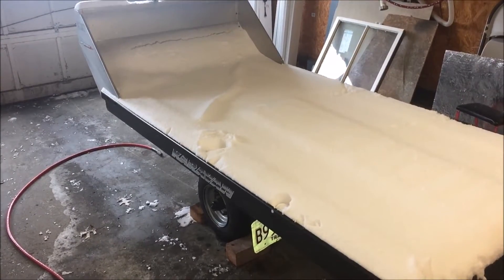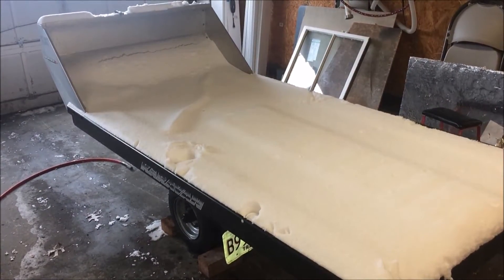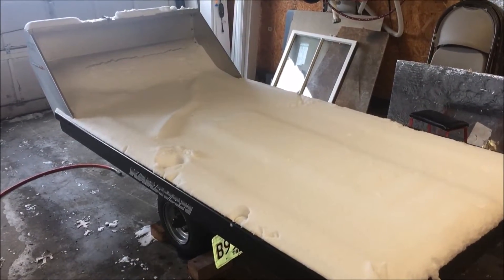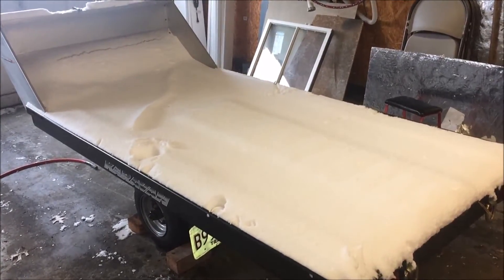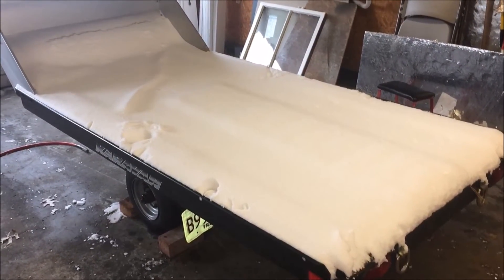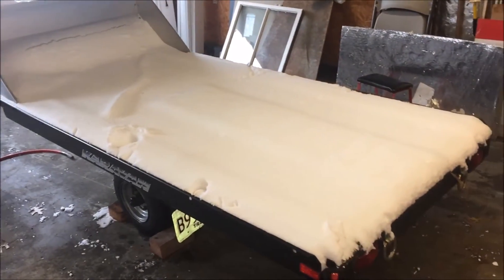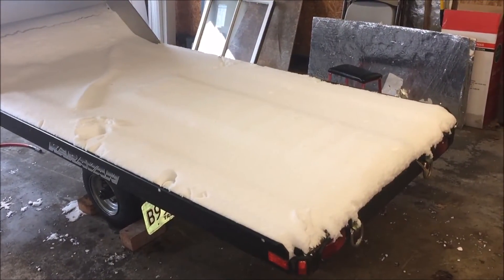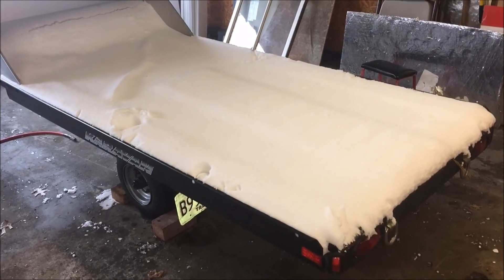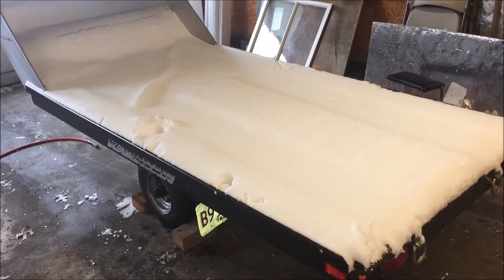I figured I'd just pass this along — this is the basic stuff I do to make sure the trailer is good to go before I leave the house. Another thing I do is bring a jack, a breaker bar, and the tools to take the lug nuts off. In the event you're on the side of the road, if you have those tools handy you can take care of an issue in five or ten minutes. If you don't have that stuff, that's really when it turns into a giant problem. Hope this helps everybody out — leave any questions in the comments and I'll get back to you. If you liked the video give it a thumbs up, subscribe, and thanks for watching. Have a great day!